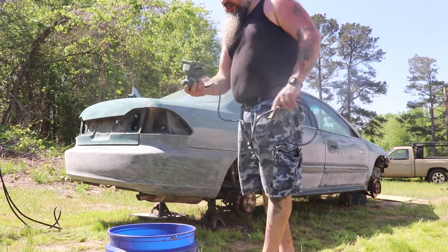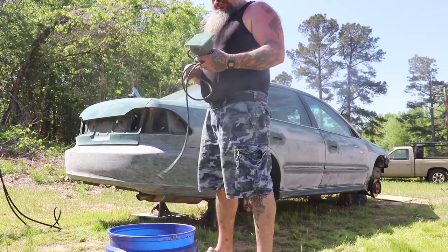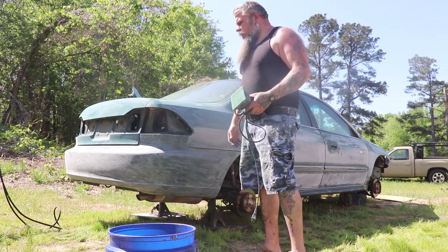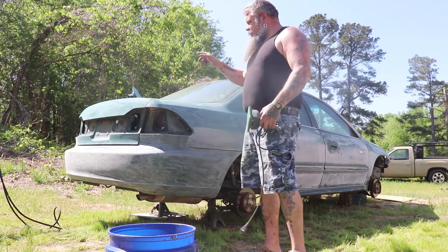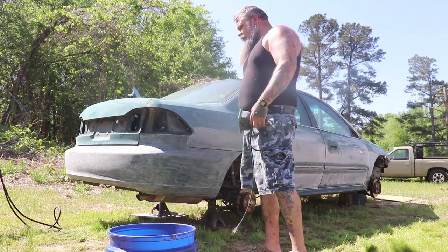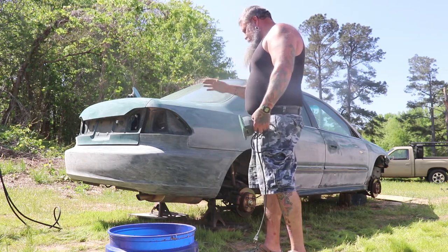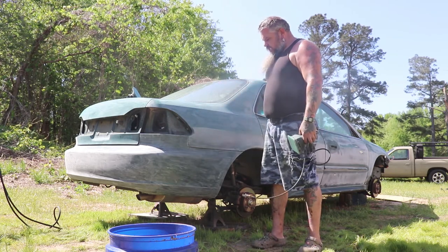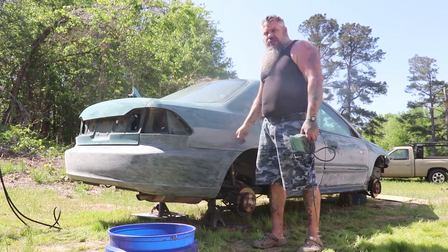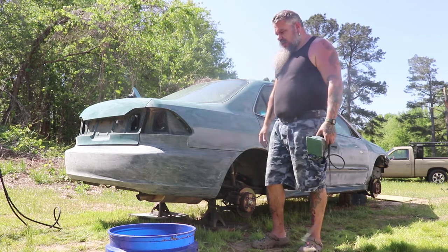Without the compressor, the electric sander kept up pretty good - no problems. It knocked the loose clear coat off immediately, so we did the whole car with this first. I probably could have gotten some coarser Harbor Freight sandpaper - would have done fine. The pads are sticking great. Some cheap pads will fly right off your sander, but these are sticking pretty good. I'm coming back and smoothing out with the 320-grit all over. I actually like a coarser grit for a project like this just to ensure this budget paint is going to stick to the car.